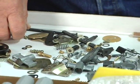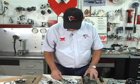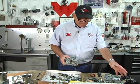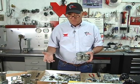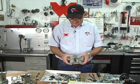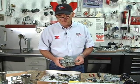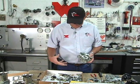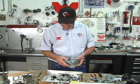One thing I forgot to mention on the primary, secondary carburetors, the jets will be different. And what I like to do as I'm dismantling it is take the main jets out, the air corrected jets, everything out of the primary side and keep it here, and everything out of the secondary side and keep it here. So when you go to reassemble it, you know what goes where, instead of going, oh gosh, I got a 135 main and a 140 main. I don't remember where they go. If you keep your carburetor divided in half and keep the primary side and the secondary side calibrated parts separate, it'll make it a lot easier for you. A lot of our customers, especially today, actually take digital pictures with their cell phone or whatever during the whole process, so they can refer back to where does this go, instead of an exploded view. If you're this far into it, you won't have problems.